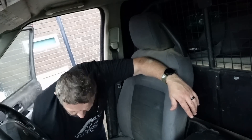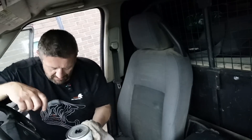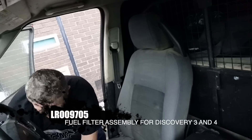I've pulled over and put 30 quid's worth of fuel in. Good news and bad news - the fuel filter I thought could be an issue, well, the one on it looks brand new. There's also a little injector pump solenoid under there that looks brand new, so someone has already tried to fix this car. I've got a genuine filter anyway - I don't think it'll make a difference but I might as well fit it. I tried to release air out of the bleed nipple but there was nothing there.